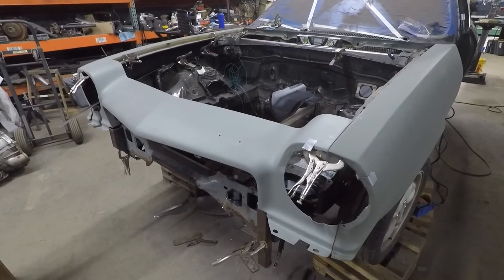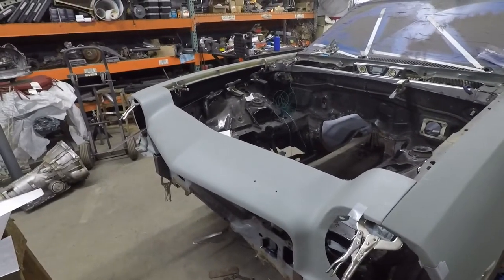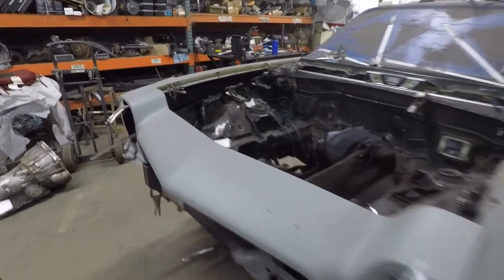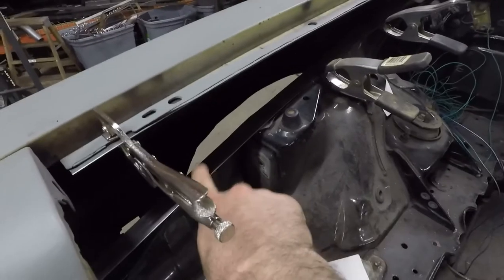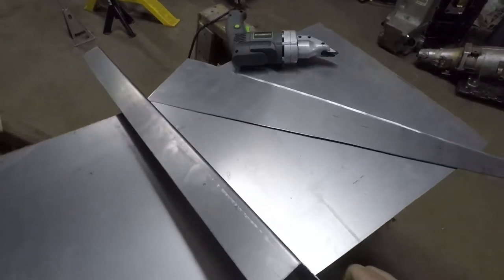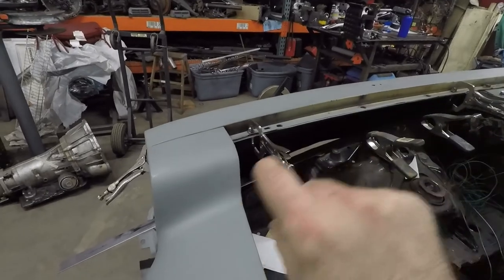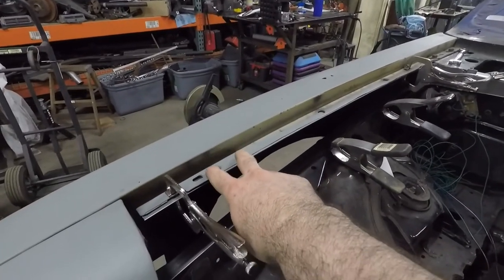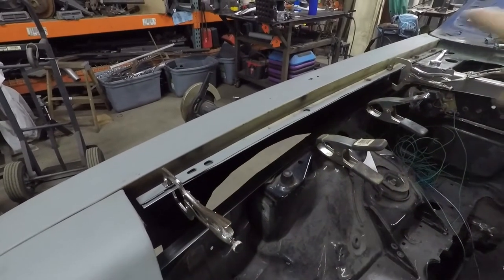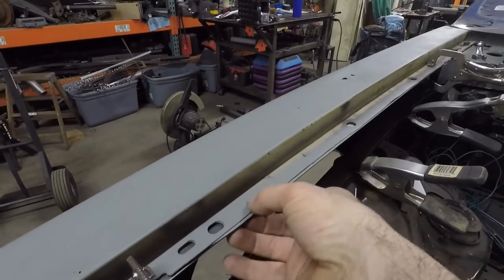The front end is back on and mocked up with some adjustable posts — not the final spot, just for rough calculations and guesstimations. I got a one-inch piece of 16 gauge, about 30-some inches long, butted up against that curved piece base. I made up some angle pieces with a two-inch lip that were going to go in there, but I forgot this has got a really slight bend — some concavity this way. So I cut that lip off and clamped it to the bottom side of the fender where the mounting holes are going to be.